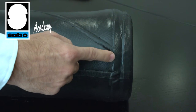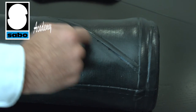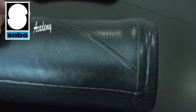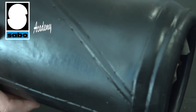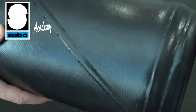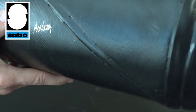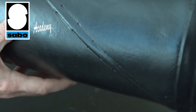With air springs, the critical stage of their construction is the overlapping of the various sheets, as this can result in air bubbles. If we take a close look, we can see that the worker has made some small holes. These ensure that once the part is placed in the oven for vulcanization, the air is able to exit, thus avoiding any imperfections or defects which might weaken the spring structure.